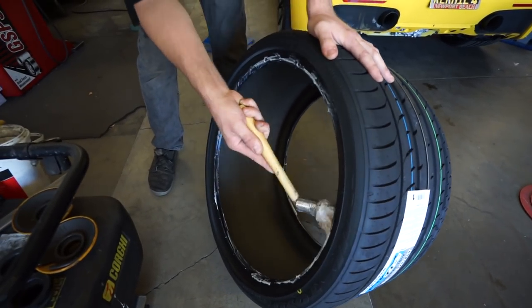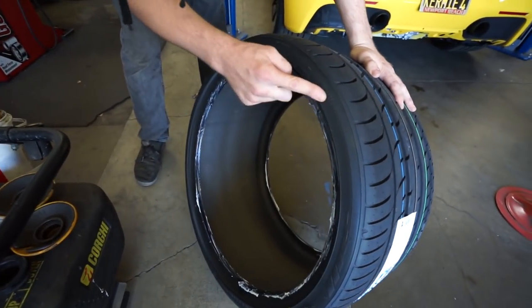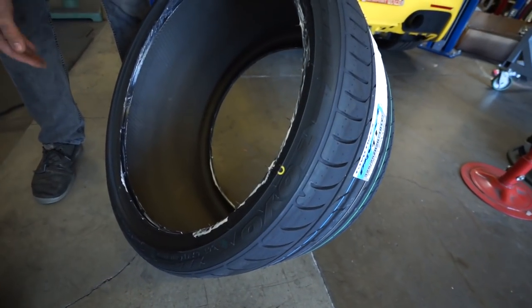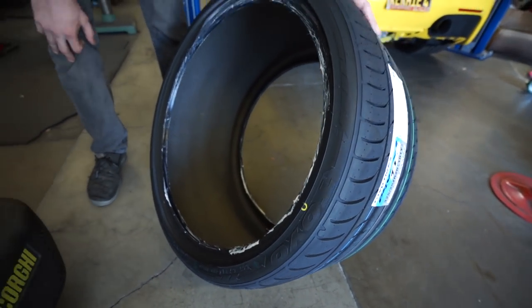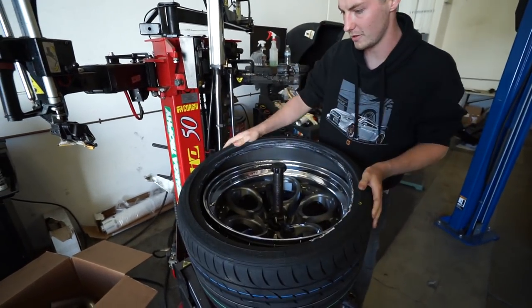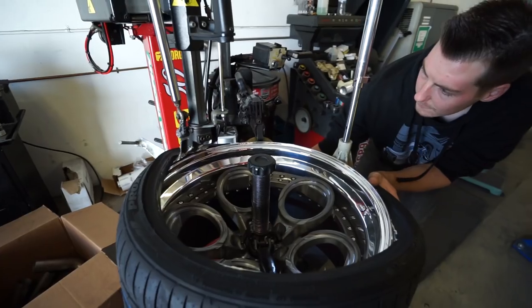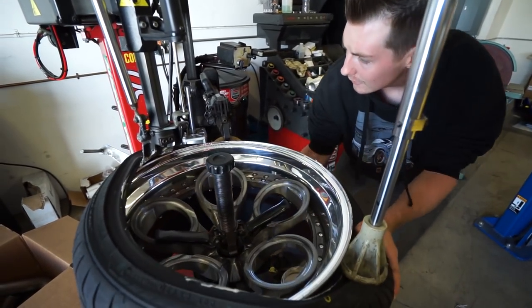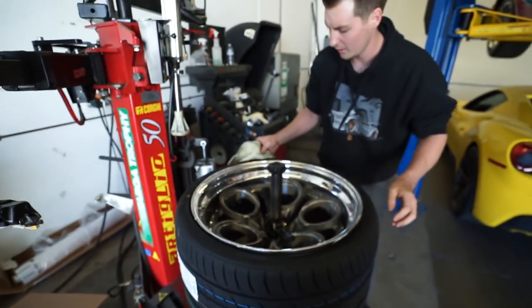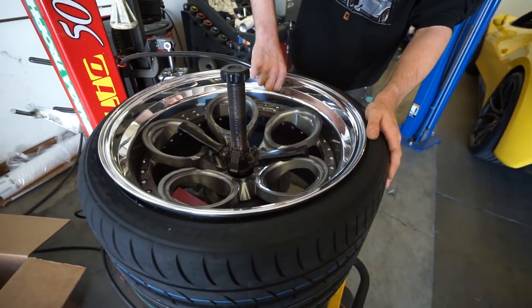These tires are actually an outside/inside tire — it's not a directional. As you can see, there's an outside marking, and the yellow dot tells you where you need to place the valve stem for the best balance. Force it on — time to mount it. Give a good wipe here. The bead's going to pop — it's going to be loud.